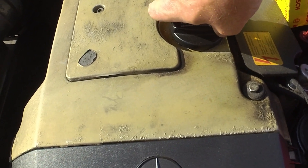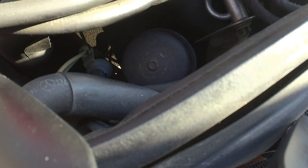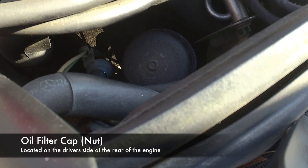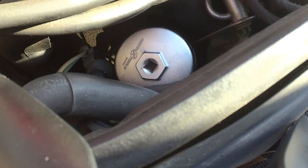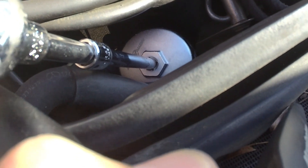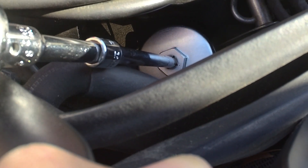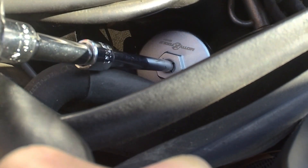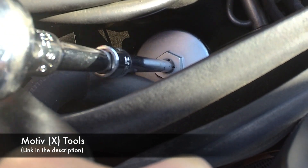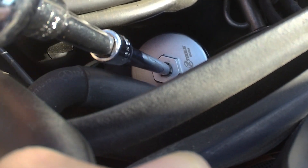I'm going to open the oil cap on top of the engine — that will help the oil drain a little bit better. On this car, the top of the oil filter housing has a nut that requires a special tool to remove. It takes this particular socket — I'll stick it down over the top of it. You really need this tool; I'll put a link to it in the description. It's made by Motive X Tools.